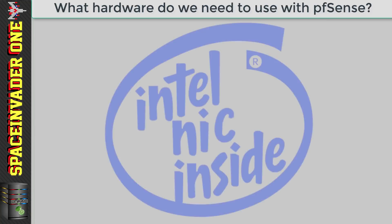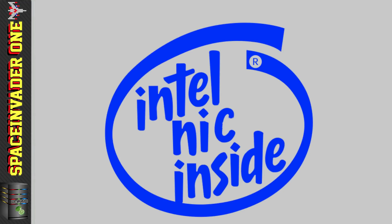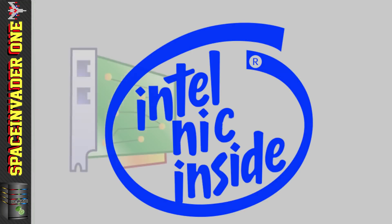It's recommended that the network cards we use for PFSense are Intel ones. I'm not saying that other brands don't work, but you're much more likely to have problems and lower performance with other brands. Often other brands save money in manufacturing by not having so many dedicated chips on the card, substituting that with workload being offloaded in software. So make sure you choose Intel network cards in your PFSense box for the best compatibility and performance. If you don't have two built-in NICs, we should buy a PCIe add-in card.